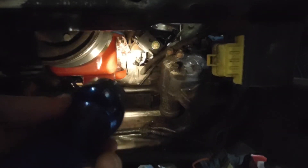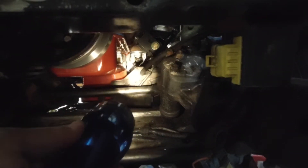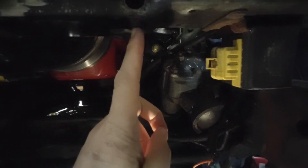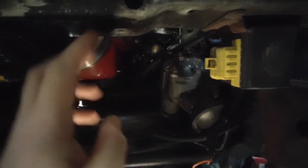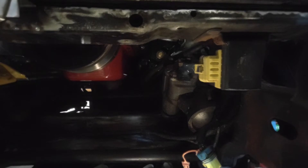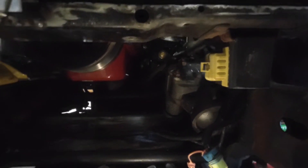Let me grab a flashlight — back there you can't really make them out, but I have some fittings pointing this way. The lines are going to run directly forward, and the oil filter is going to mount here. Then I can turn the engine over and do a couple more things like torquing the torque converter bolts and loctiting them.